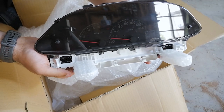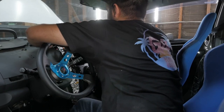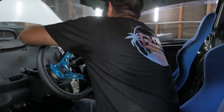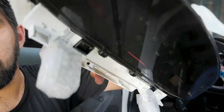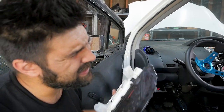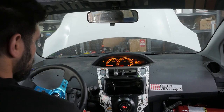Since this Yaris was originally an automatic it didn't actually have a tachometer in the gauge cluster. So I've got a gauge cluster from Japan shipped and ready to install — sit back and enjoy this view of the back of my arm. The original gauge cluster only has the speedometer, no tachometer. That's why I've been using this little guy down here, but now that I've got the JDM one — yes it's going to read in kilometers — it's going to have a tachometer and I can do away with the old one. Well, here's hoping this is plug and play.